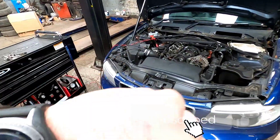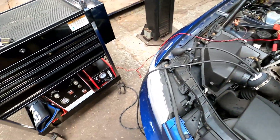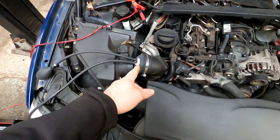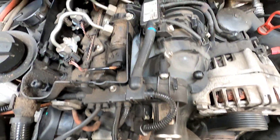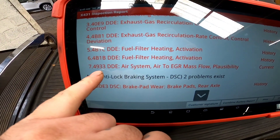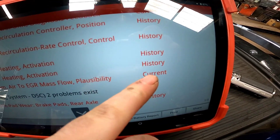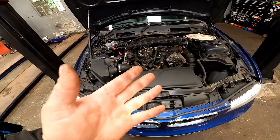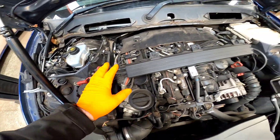Welcome on this fine Wednesday morning. We've got a BMW 123d in with lots of fault codes. As you can see, I've got the smoke machine coupled up and we have smoked that engine — we have got another manifold failure. The fault code I'm most concerned about is this one here: air system, air to EGR mass flow plausibility, which is a current fault. As you can see, we have got a leak.